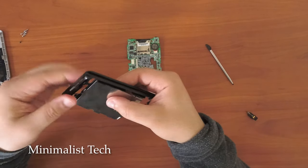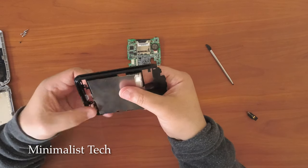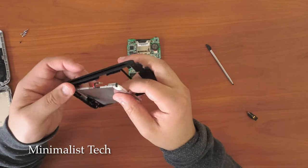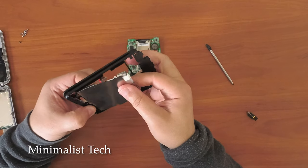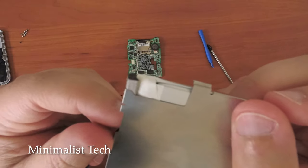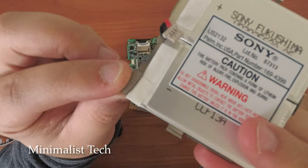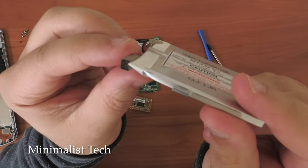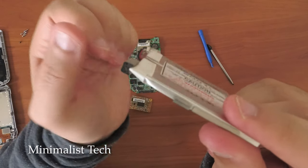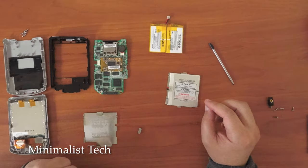The black plastic part opens up on just one of the sides, which is where the WiFi is routed through. You push it in and it releases, and doing so also releases the pressure so you can much more easily remove the motherboard. See how easy that is — now we have access to the battery and the heat shield without it being destroyed. There's the bottom tab that needs to be removed and then the top tab. Just wiggle it and put a little pressure on that tab to get it to release. There's a little piece towards the bottom of the battery, so just make sure you replace that. If you're installing a new battery, it's supposed to be located there towards the bottom.